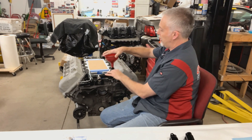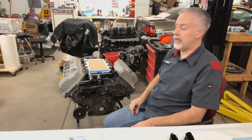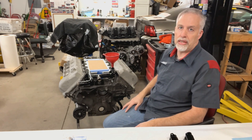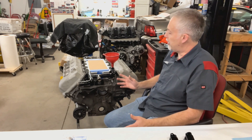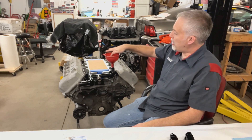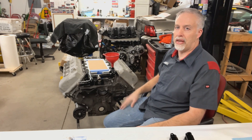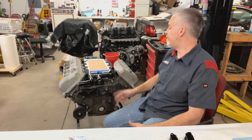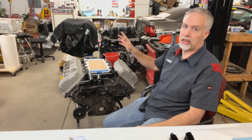You've got to take this out, and what I prefer to do is get a funnel that fits in there nice and tight and add coolant while the engine's running. You fill it up initially, then get it running and add coolant until it sits about halfway up in the funnel. You wait and it goes down, wait and it goes down while it's running, until it's not doing anything anymore. Shut it off and put the car away for the night.